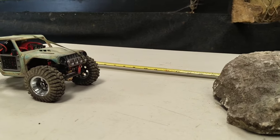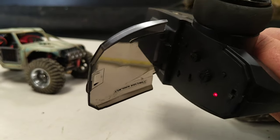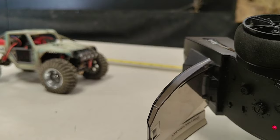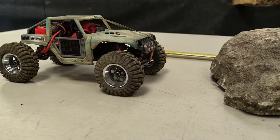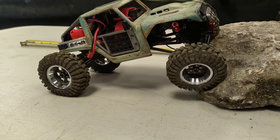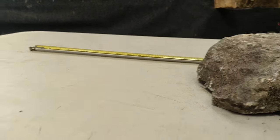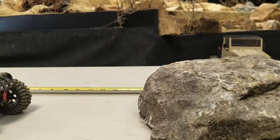So I'm going to put it back on the low again. And I'll show you what I mean with these. So this is the low setting again. Squeezing, squeezing, squeezing, still squeezing. And we're away. Nice and slow. Very juddery. Binding. Fingers literally buried now. And, you know, it'll go over. So you've got very little throttle control on the low.